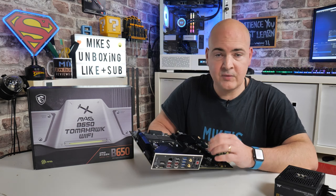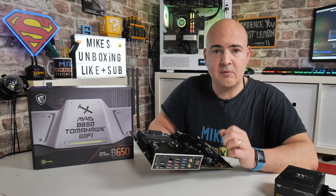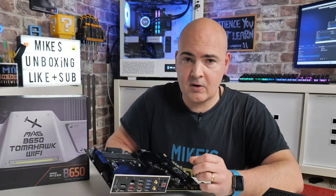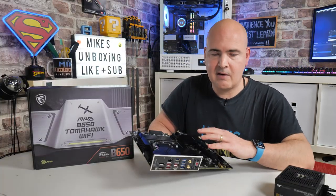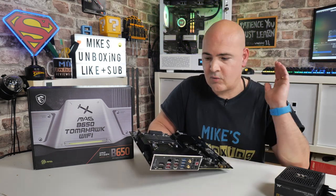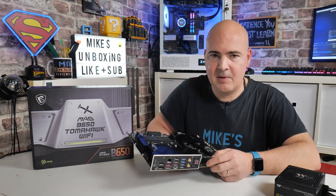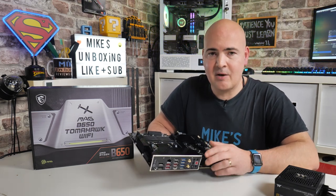Just before I get the first install on it, just so you know I'm on the latest version. Something else this update introduces is a new feature from MSI called TDP Overclocking — a super simple way of overclocking your processor. Rather than manually configuring anything yourself, you can select your desired TDP and it will just run at full tilt until it hits that TDP, giving you an extra boost in theory. With that said, let's get on with it.